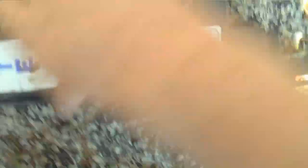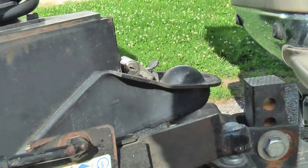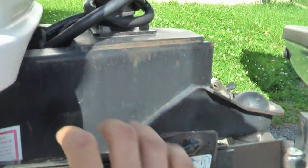This is what it looks like. It's almost got like brake pads inside here. Turn this lever to loosen it, then this will slide in and out, like so. This goes right here — pull this pin out. This one goes right here, you tighten this down. It clamps down on the center piece and it reduces almost all of the sway. There's still a little bit of it, but when you compare to what it's like without a sway bar on, there's no comparison.